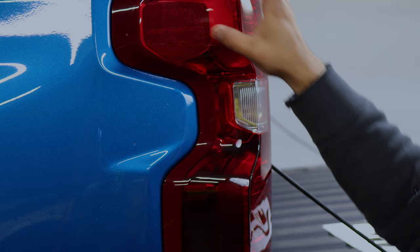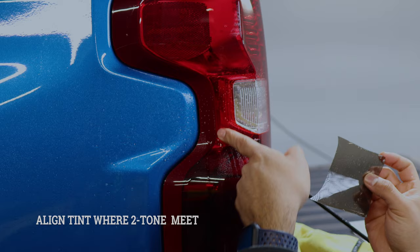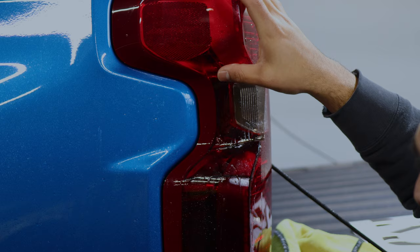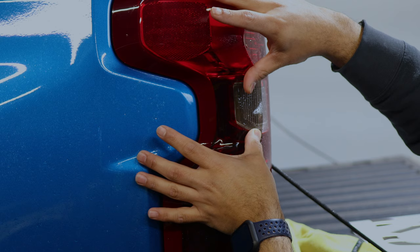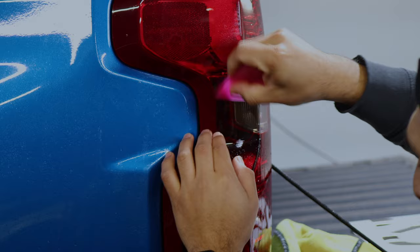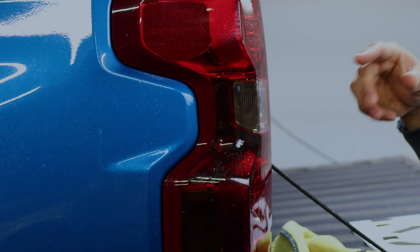The next step is moving on to this piece, and it's the same steps until we finish the top piece. Apply your slip solution and align it right on the edge where the color is about to change. Once aligned, tack it down with tack solution — you can use your finger to tack it down. Once it's tacked and not moving, tack down the rest with your finger so it sits in place. Spray tack solution one more time, then squeegee to remove all the solution from the back. Finally, seal all the edges with tack solution, heat, and a microfiber towel.